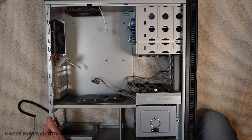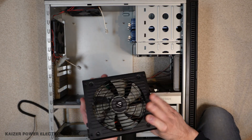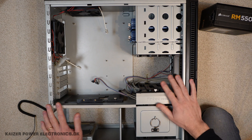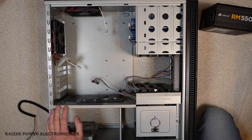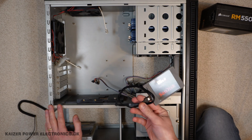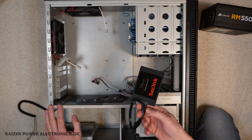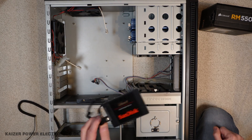So what did I pull out of this? I had a Corsair 550W power supply that had some startup issues — it actually tripped the fuse in my house when it had been powered down for a while, so that's gone bad. I had my solid state drive, 256GB. I actually tried to clone this to the new drive, and what I did was ruin my dual boot Linux and Windows boot sector, and I just got a grub rescue prompt — so that kind of sucked.